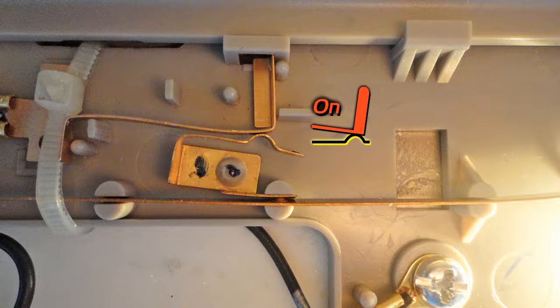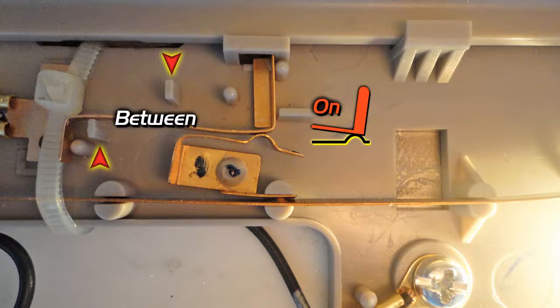Obviously, zip ties don't last forever, so you can choose to add more ties as long as they fit inside the assembly. The advantage of this over the stiff round pins is that the ties are made of flexible nylon. If the switch moves back and forth horizontally, it's fine, because no sharp part of it is touching the tie. Moreover, what really matters is the fixation of the long arm between the rectangular pins. As long as it's sandwiched there, the switch won't fail.